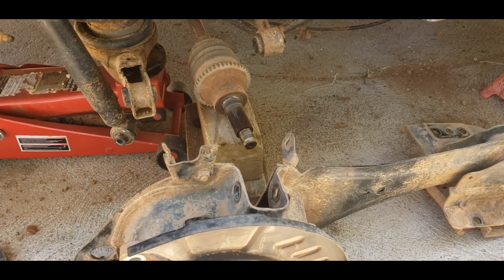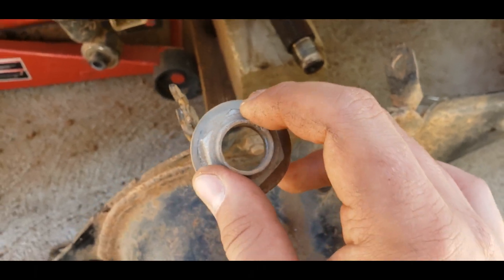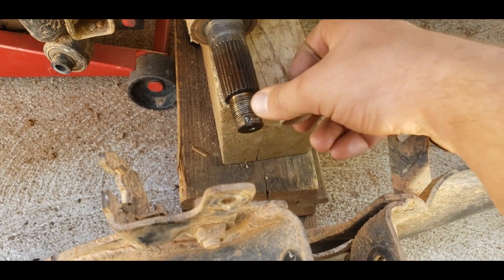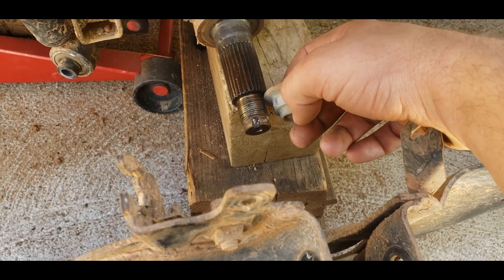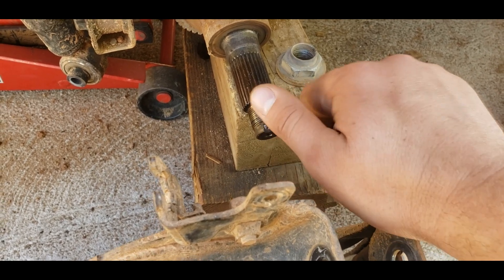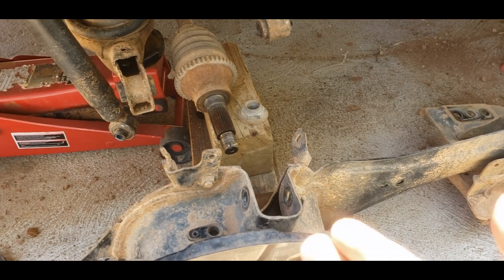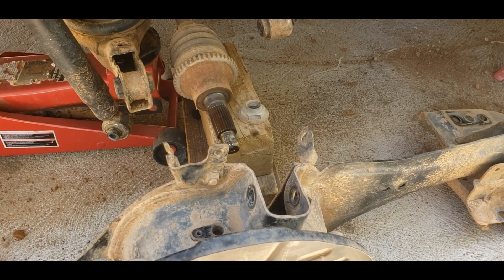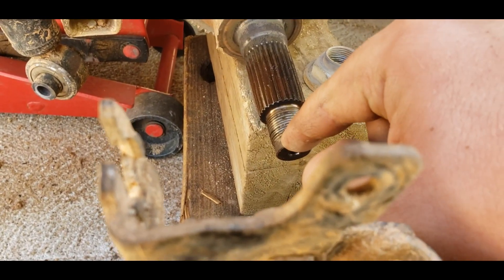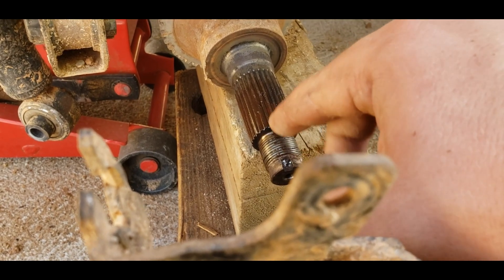The other thing while we're talking about the spindle: the nut is staked — right here you can see where I beat it back out. When it's on the CV axle there's a divot they put in, and when the nut is on there you're supposed to take a punch and hammer that material in so the nut doesn't spin off. To get the nut off you kind of have to beat that back out so it's round and it'll spin. This flat portion of the nut — if you don't do that it's just going to catch on this little cutout, but the flat part of the nut material is not going to be touching the threads.